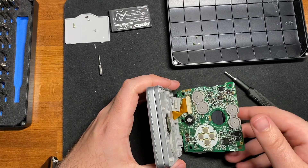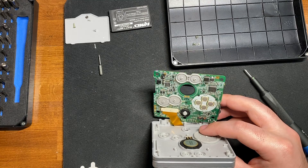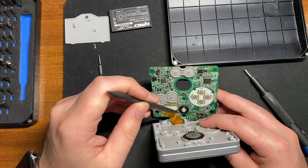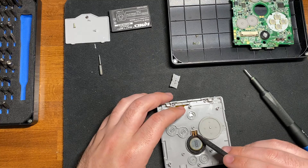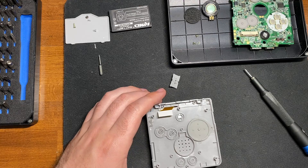Carefully lift the motherboard back and up. You'll see the power switch and the screen's ribbon cable at the top. You can take a fingernail or a spudger or pry tool and gently pull down on the latches — it'll pop right out. Then the whole thing can come out. The speaker should be a little loose; it might have some adhesive underneath or it might just be wedged in. Pull it out with a pry tool and set that off to the side.